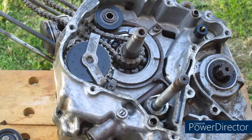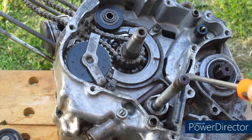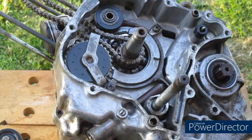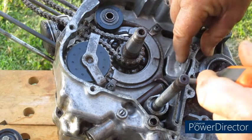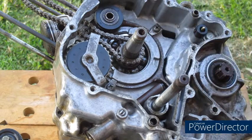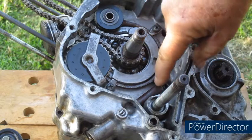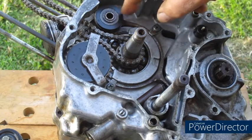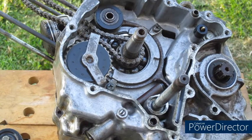This gives us the correct tension. And as I said before, you can see on this engine that once the chain becomes so badly worn — or the components, the rollers, etc. — this adjuster touches against the casing, and no matter how much compression or force we put on that plunger, it will give us no more adjustment. Hope this helps and gives you the confidence to tackle this job yourself. Thank you for watching.